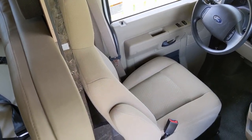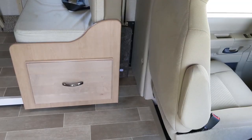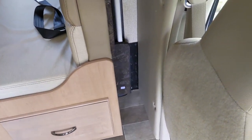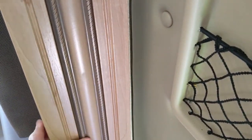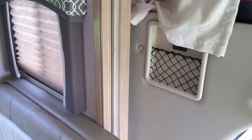First thing I do is move the seat back a little bit away from that, flip the back up a little to get it out of the way. Then we run the slide out. There we have it with the slide all the way out. Then I take a piece of trim — top edge goes right up under there, get the curtain out of the way. I just take my foot and push that Velcro in down there. Velcro at the top, one in the middle. And bingo — we've got our trim piece right back in. Just looks like factory.